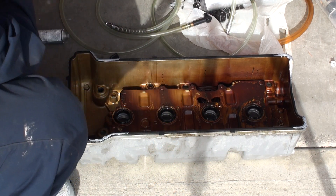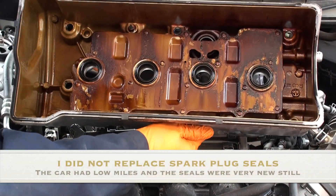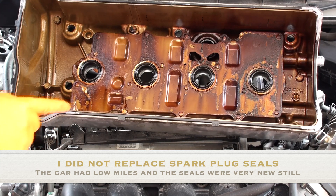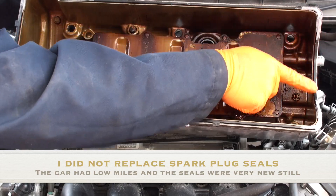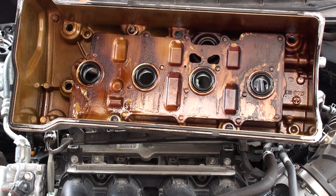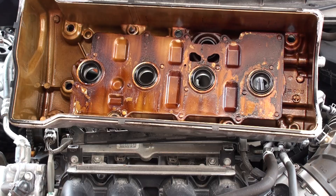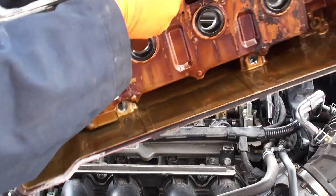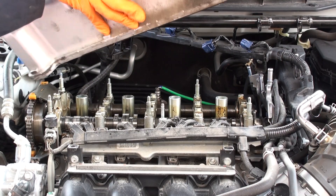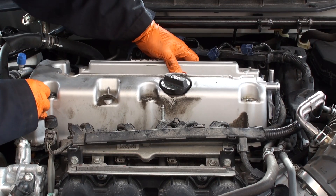You don't want to apply blobs of sealant, but you also don't want to apply too thin a layer. As a recap: on the cylinder head when I pulled this off, there was liquid gasket in this region here as well as the curved surfaces towards the driver side of the motor — so I'm just replacing it with what came off. Now I've allowed the gasket material to set for about five to ten minutes, so we can go ahead and reinstall it on the motor by doing the reverse of how we took it off. Reinstallation is actually easier than the removal.